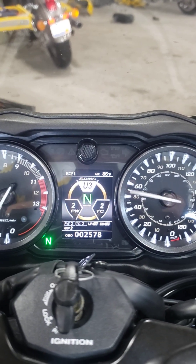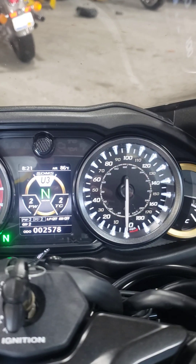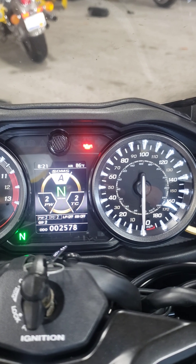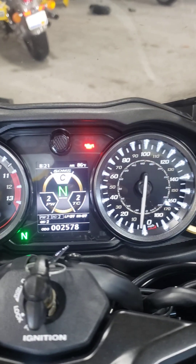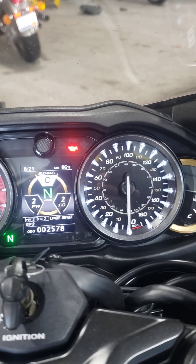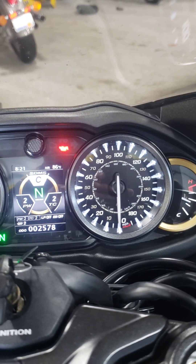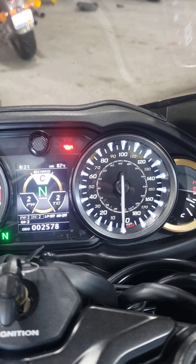U3 at the moment I don't have anything creative to do with that. So I've turned the speedometer into speedo, MAP, throttle, lambda, and air fuel depending on how you want to look at it. Pretty much any signal you're interested in, you could make it display on the speedometer as an auxiliary readout.